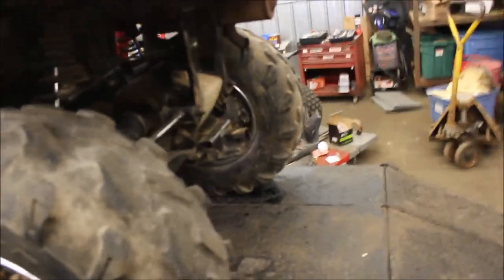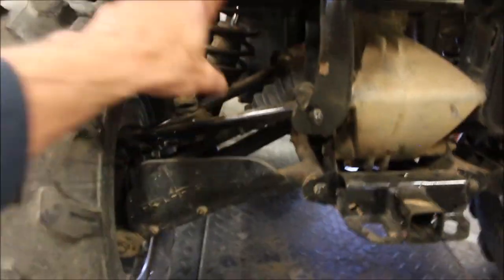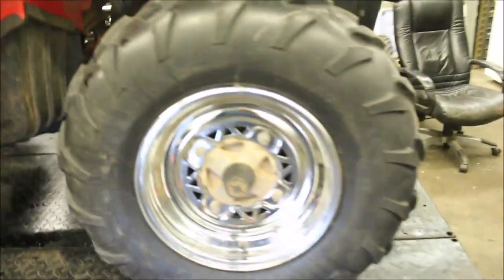While I've got it up here, I want to check all the grease zerks. There aren't a whole lot on this 2008 — normally there's some here, some down here. I was actually surprised they took a lot of them away. On your prop shaft right here there's a grease zerk — I actually installed a newer one, so I already greased those up, that's good to go. Just kind of look over everything and grease everything up.